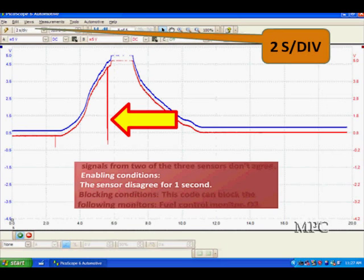We used a lab scope here. We're going to talk more about using lab scopes and look at this again later. When we did a sweep test, we moved through this bad spot fairly quickly — it's up around 90% throttle. If we were driving the vehicle very fast and actually held that spot for a longer period of time, it would fail.